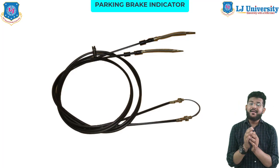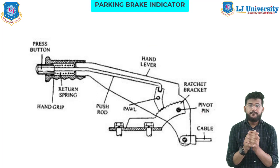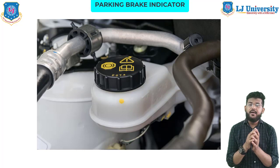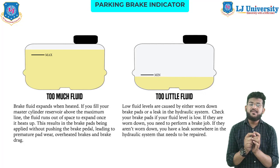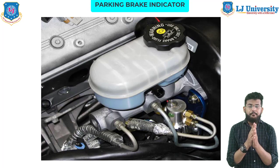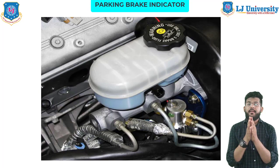Next, sometimes the trouble isn't with the switch or the cable but with the parking brake system itself. If the brake does not disengage when the handle is lowered, the warning light will stay on. You need to check the system's connections. Another cause is low brake fluid — the parking brake light is a multi-functional device designed to illuminate if the fluid level in the reservoir drops below a certain point. You may notice the light turning on and off when going around turns as the fluid level shifts. Additionally, your master cylinder is equipped with a brake fluid level sensor, sometimes mounted in the side or as part of the reservoir cap. If the sensor fails or is going bad, the parking brake light will turn on.